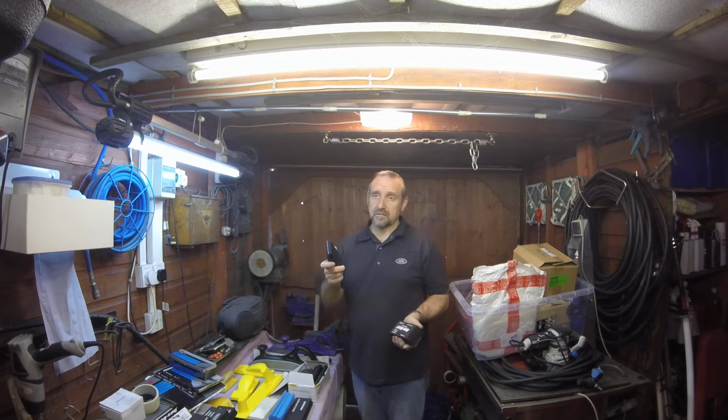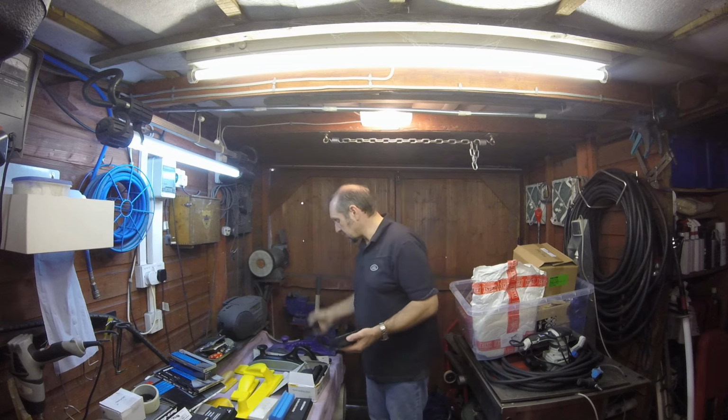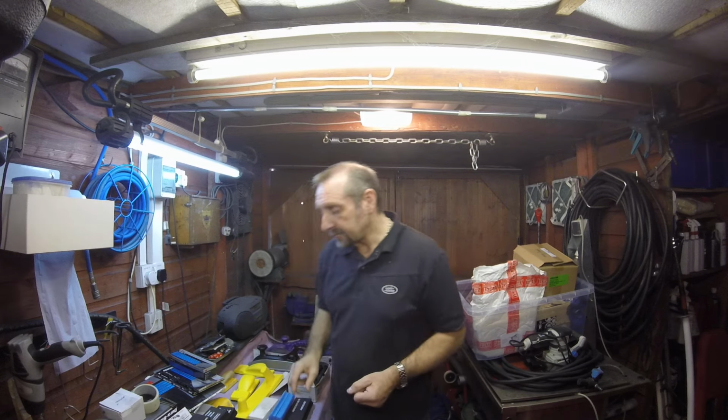Obviously if you put a guide coat down that's a dry guide coat, you have to sand dry, you can't sand wet, otherwise you just wash all the dust off.